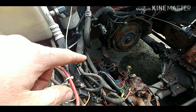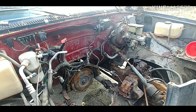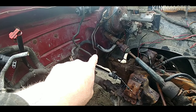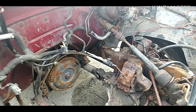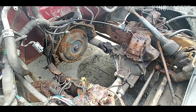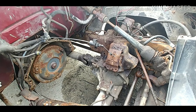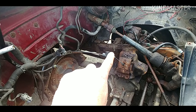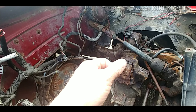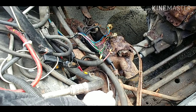We're back at it here this morning. I got the motor out yesterday — I just took my time, didn't really push that hard on it. We got it done late last night around five o'clock and then it was dinner time. That's what the transmission looks like in there — you got the three torque converter bolts to get out and then the six bell housing bolts, which were actually surprisingly easy. I dropped the starter down there — that's an old starter. I might use it, might not; I have a brand new one that was supposed to go back in when I put it back in but for some reason didn't. So motors out.